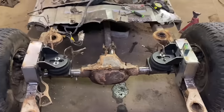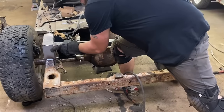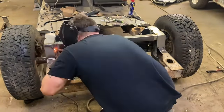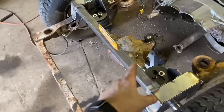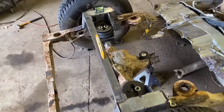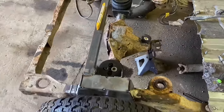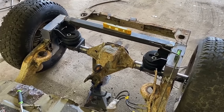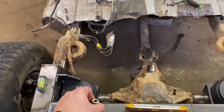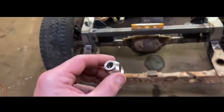We got them in - both of our little frame sections. Bada bing - you love to see that. Went in there perfect. Really tied everything in very well - that's a big piece of metal, it's real thick too. I might not need anything up front. Usually guys will run one on each tower but this is like quarter-inch tubing, so it's definitely not going to flex. Everything's still level, everything's square, wheelbase is perfect. I want to seal this up - I'm going to put these fittings in because I don't like it being open while I'm grinding and welding - you can get shit inside the bag.